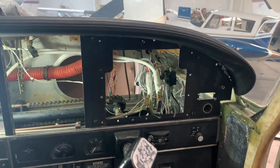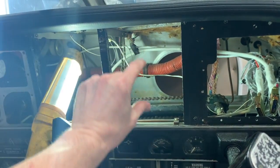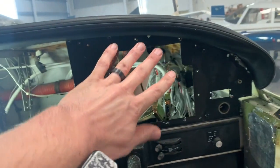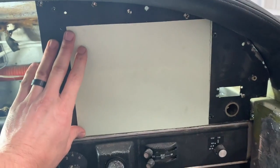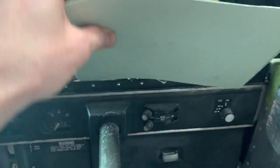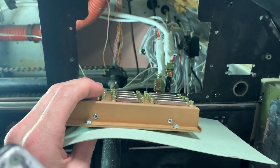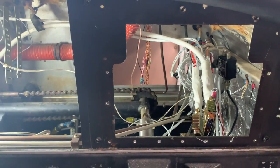SITREP: I am hooking up the power, ground, and lighting for the harnesses today. I decided to open this up since the engine monitoring is going to go here — the GI 155 — and the stack of other stuff: autopilot, audio, 430, transponder. That leaves this whole area open, so I created a plate that's going to go right there. I'm putting screws on it so it can open up, and on this side we'll have the box mounted. If I ever have any issues, I can just pop those off, unplug them, and get right to it. That should work out really well and keep everything up nice and high away from the yoke, so whenever it moves, no wires are anywhere near it.